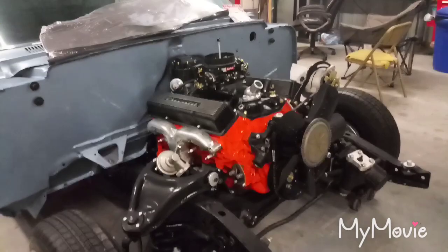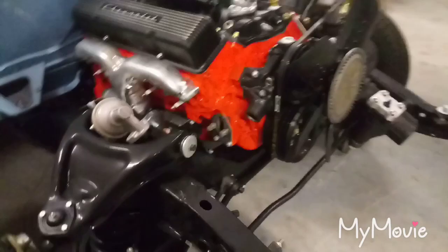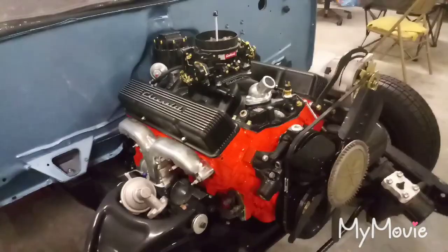When it came time to put the bolts in, I had to take the fuel pump off again — that's the third time — so I can hammer in that passenger-side motor mount bolt. I'll need to go get another gasket now. The driver's side motor mount went in pretty easy, just went in by hand and lined up good.